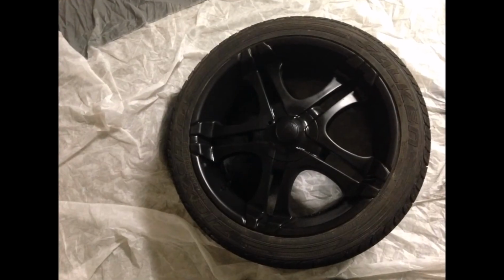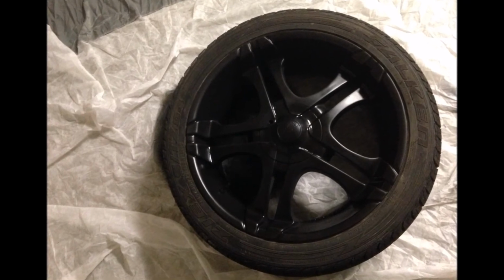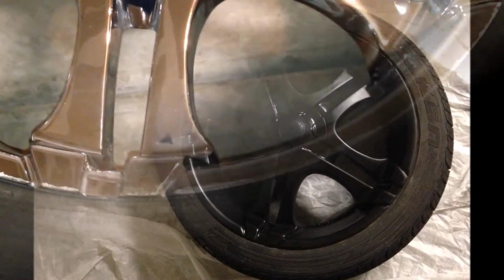Right there I'm showing areas where I missed a spot. You saw a little orange that was from the glazing putty that was left over. But overall, the rim turned out really, really nice. And with this Plasti Dip, you gotta take the masking away before it dries, because it'll bridge and pull away. So it was wet, and I was able to touch up those areas that didn't get covered so well, just because it was still wet or tacky.